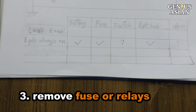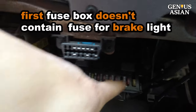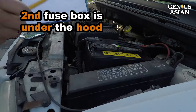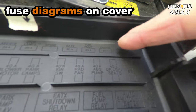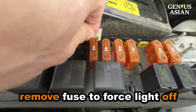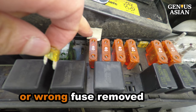This is the easiest and we will show you how. This Dodge Caravan has two fuse boxes. The first fuse box is under the steering wheel, but this one does not contain the fuse for the brake light. The second fuse box is under the hood — you push this tab to open it. On the cover there are diagrams to show you which fuse is for the brake light. After removing the fuse the brake light should be off. If it does not go off, then there are wires shorted somewhere or maybe you removed the wrong fuse.